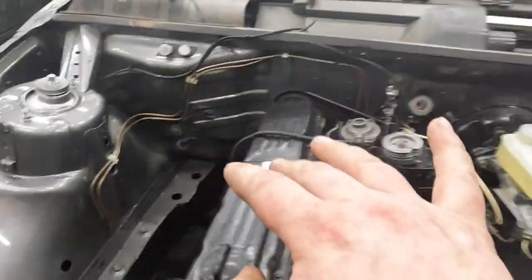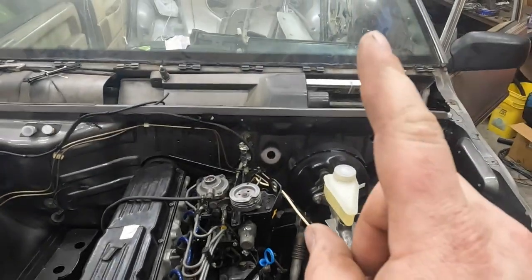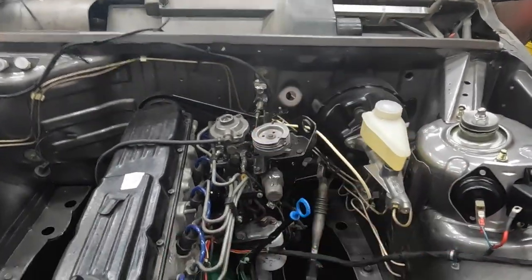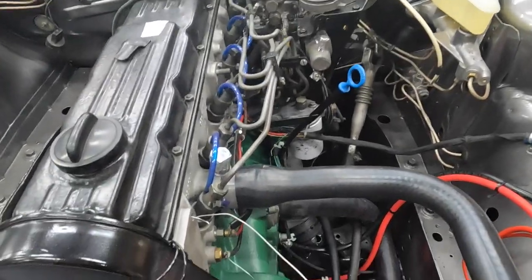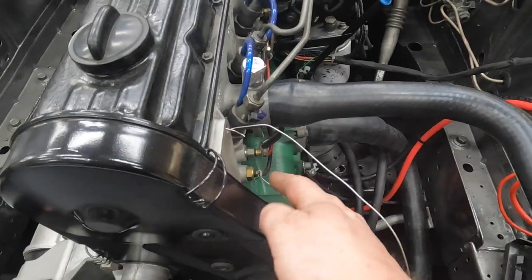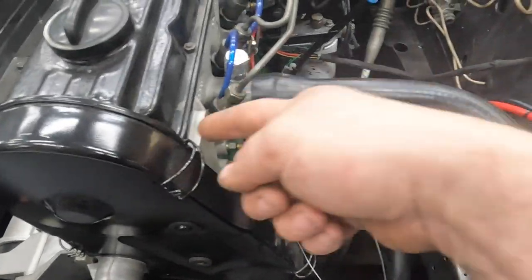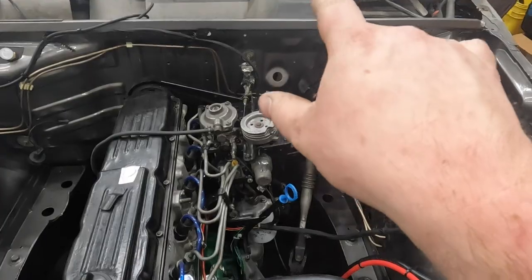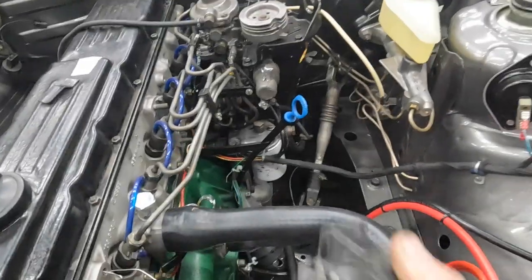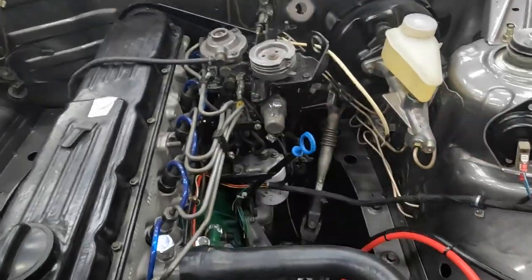Now that's all looking quite handsome now that it's tidied up and dressed out, so we can move along to some safety items like maybe lights and a horn and all that. But first, let's test some things. Here is the sender for the temperature gauge in the cluster — I have some wire here grounding it out, because all that gauge is measuring is the resistance between it and ground. And I have some off-the-shelf Hella horns to put on, so let's give her a test.